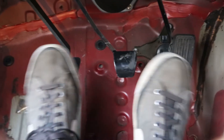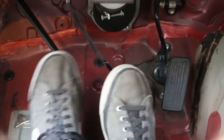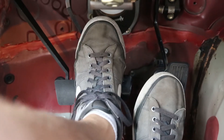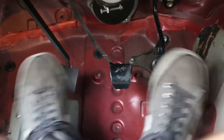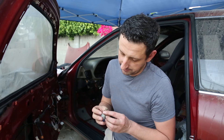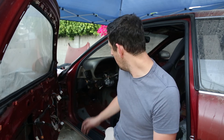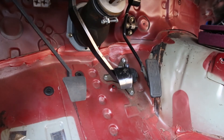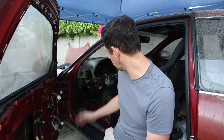That could have gone a whole lot smoother, but I do at least have my clutch and brake pedal set up now. I'm not worried about my clutch foot hitting my brake pedal — I would have to be really messing up to reach all the way over and hit it by accident. I did break my brake light switch, but it's a $10 part and the plastic was pretty brittle from age, so not a big loss. The brake pedal is placed nicely in the middle between the clutch and gas pedal, so there won't be any accidental left-foot brake stabbing. It's way safer than cutting down half the automatic brake pedal, and I feel much safer having a part designed for this car.